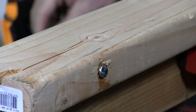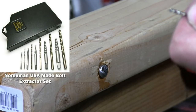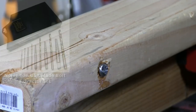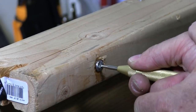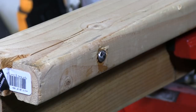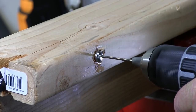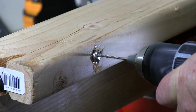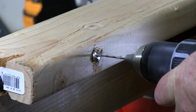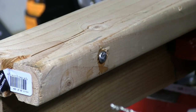So I'm going to switch to removing it with a bolt extractor. I have to drill the center — I'm going to take my punch and punch a starting point in the center, then drill a hole in there for the extractor bit.